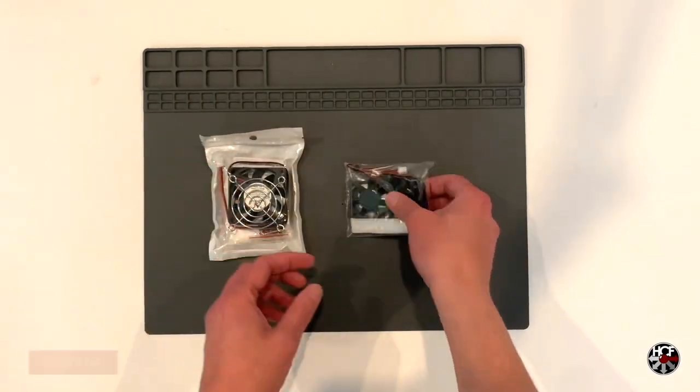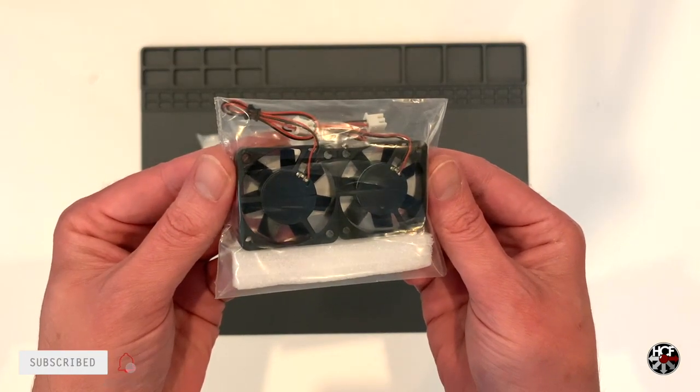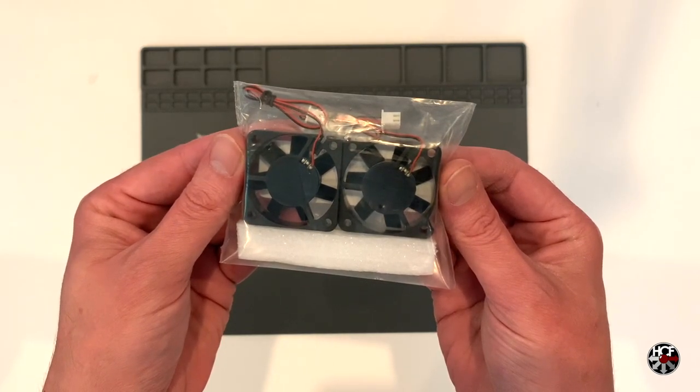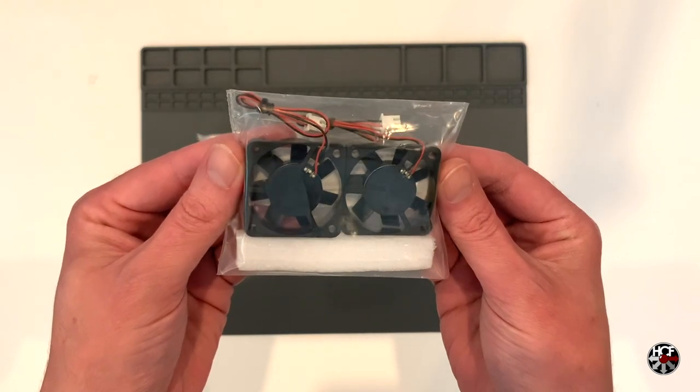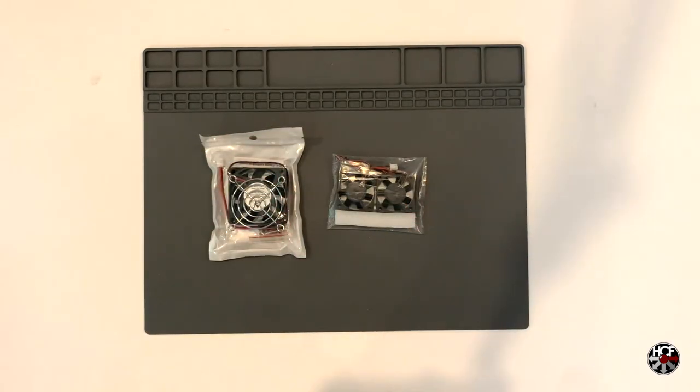The OEM SEPA HFB44B05A CPU fans are a little bit more specialised. Direct replacements are available, but they're pretty pricey, so as an alternative we're going to be using two Sunon KD0504PFB 40mm x 10mm 5V fans. You can grab these from a couple of different places online for around about $8 apiece. Now we've got the new fans, let's get these installed.